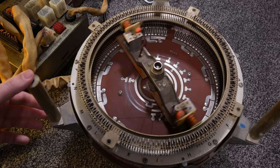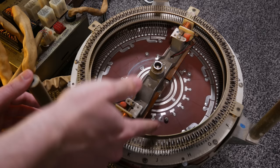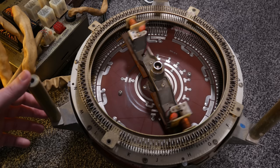And in this shot, the selection accumulator is hooked back up to the jukebox, but it's not where it's supposed to be, it's just sitting on the floor. Every single time I push the armature by hand, just a little bit, it springs to life and makes a 180-degree rotation before stopping again.